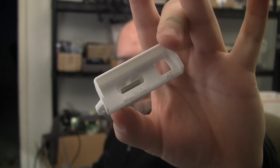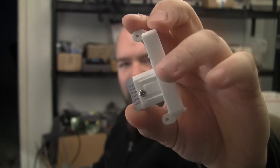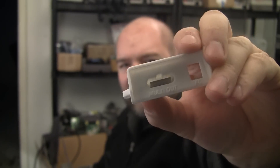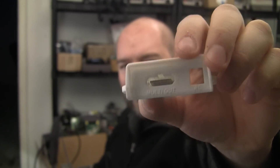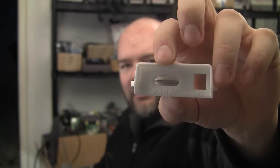This is not really an NES RGB update, but it is related. It's been something I've been wanting to show everybody for a long time. This is the new 3D printed replacement rear panel with integrated Super Nintendo multi-out connector and a hole for a new AC port. I finally got a customer that's going to have it installed on his top loader, so it's perfect time to make the video.